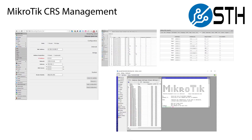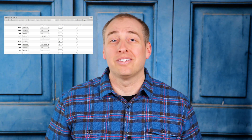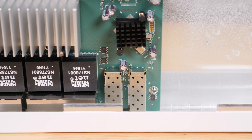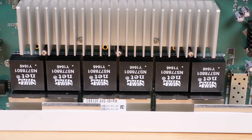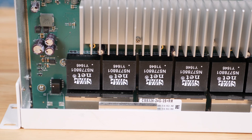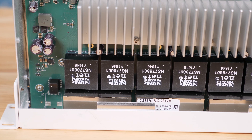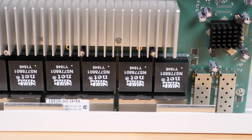There's one big difference between the MikroTik CRS 326 and the CSS 326. The CRS 326 gives you the flexibility to run either Switch OS or MikroTik RouterOS — their OS used on all routing devices. Switch OS is more focused on basic switching features, and that is what the CSS 326 uses. Some people have preferences on one end or another. Older versions of Switch OS had some bugs, but the newer versions are much better. You do give up storage and the capability to run RouterOS, which is really fine if you're just using this as a basic switch — which is really what it's intended to do.